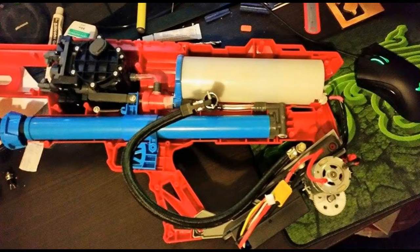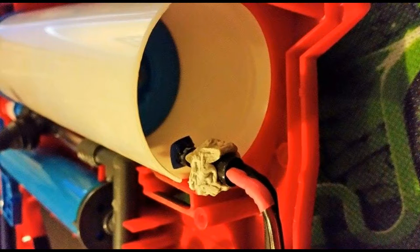These pictures here are from when I originally did the modification. This one shows where the Schrader valve has been spliced into the air system. This second photo shows the check switch used at the back of the bladder — as the bladder expands inside that cylinder, that blue piece comes towards the camera. That little switch I epoxied into place cuts power to the compressor as soon as it's pressed down. So once the bladder reaches maximum extension, that's when the airflow is cut. But even if this switch were to fail, it's not a big deal because the overpressure valve on the bladder is still intact — it would just vent out the excess air.